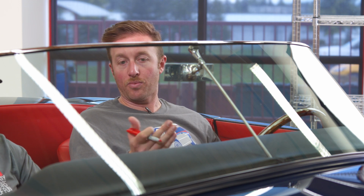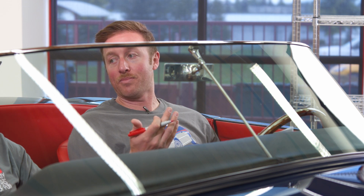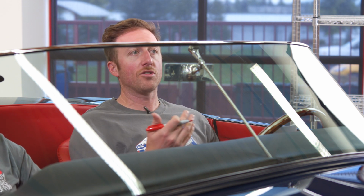And I think to your point, our collective point, finding something sacrificial and finding the boundary is just like threshold braking in a race car. You've got to know where to stop. And that tool, you're using it for spot treatment a lot. That means you're focusing energy and can heat something up a little faster, but it may also mean that you're just working a small area and you may never generate the temperature to burn the paint by the time you've finished your polishing process.